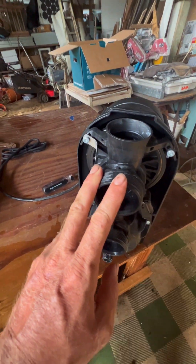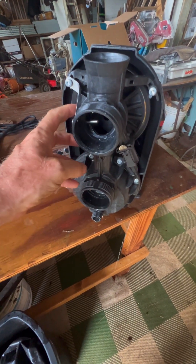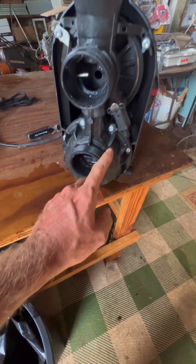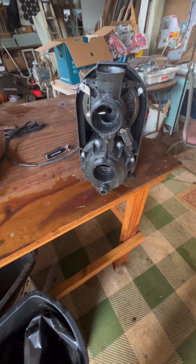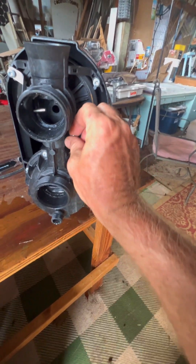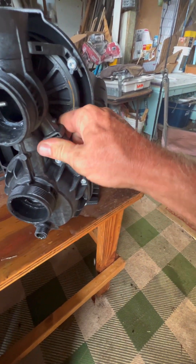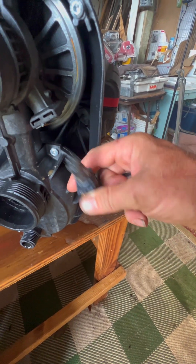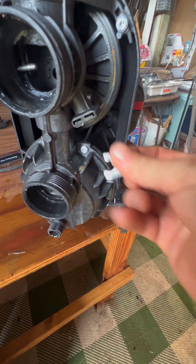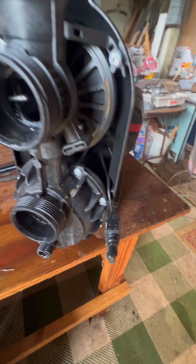So I have a spare part — I don't know what this is called exactly, but there are two screws there and then eight around this, so take off those 10 screws. This comes out; it's just a little clamp that holds this plug in. With that clamp out, this pulls down and out.